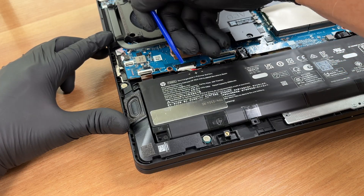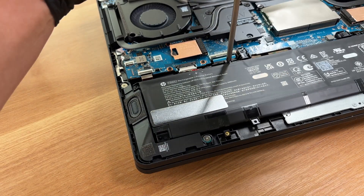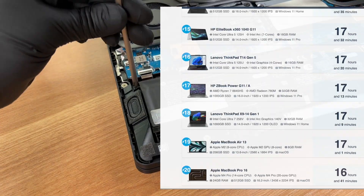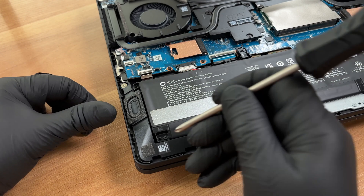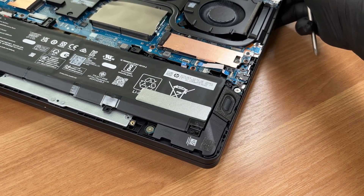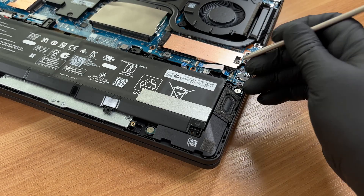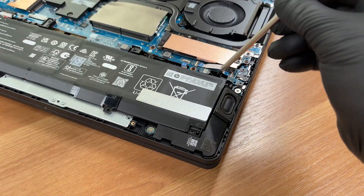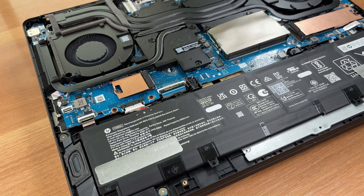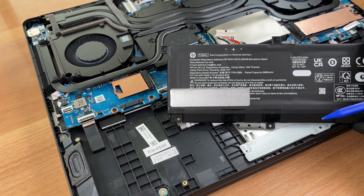Unplug the battery harness and keep the cable clear. You can check the result of our battery life test on LaptopMedia.com — the link is in the description below. Remove the six screws and lift the pack out. Don't forget to visit and see our top 100 laptops with the best battery life ranking page. Here's the battery: model FZ-06XL, 83Wh.